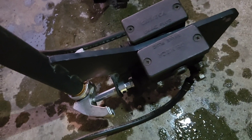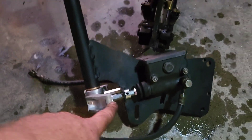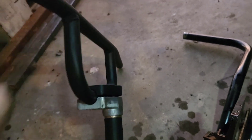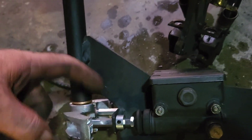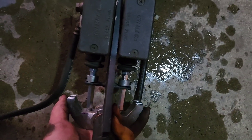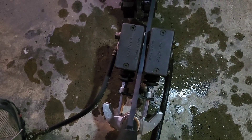Now I'm going to strip all that stuff off there, put it on the new bracket, and then mount that. And there we have the finished product. I've got those mounted back on there again. As you can see, as you twist - that's how that works. Next I'll put on the brake system. So that's the handbrake - it's a handbrake for the handlebar. It'll have a wire coming down and connecting right about here, then going over the other side right in between here, looping around and coming back over here. So when you squeeze your handbrake, the handbrake will squeeze both of these at the same time and stop the machine - basically pulling both levers back at one time. Same concept. So you can actually brake and steer at the same time as well - kind of cool.